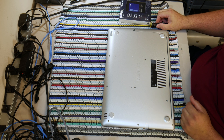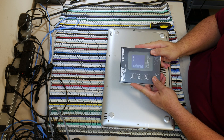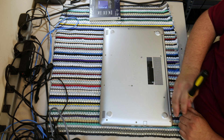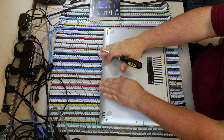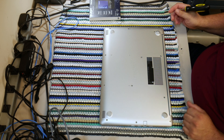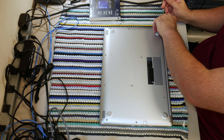We're going to disassemble a Dell Inspiron 17 5000 series — this specific one is model 5770. We're going to install a solid state hard drive to replace the mechanical hard drive that comes with the computer. One of my favorite things about these computers is that even though they don't have a little cutaway plate, this whole back is generally one big plate. Instead of having a cutaway for each piece you can upgrade, you take one big back plate off and you typically have access to everything. The big downside is that means we have to take a lot more screws out.